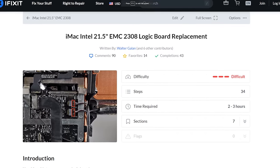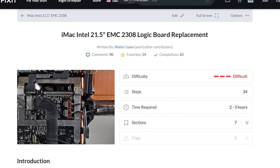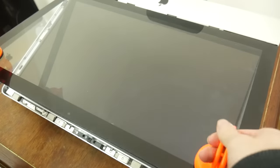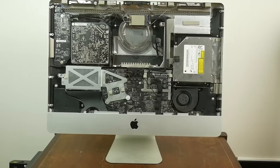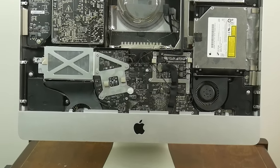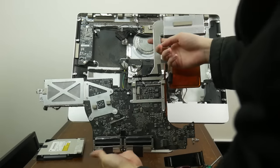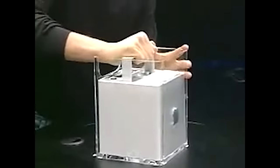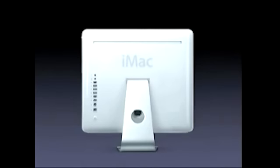Why only have one working iMac when you could have two? I decided to start disassembling the dead 2009 model, which iFixit labeled as 3 out of 3 difficult. And they're not wrong. The only way in is through the screen, so you have to use suction cups to lift the glass off, which is held on with magnets. Then you get a hundred other components and wires out, and finally the logic board itself is tucked into the unibody case, meaning you have to maneuver it without snapping any of the alignment pins. Basically, yeah - 3 out of 3 difficult. Apple used to advertise their computers being easy to open - you just unscrew three screws on the bottom and the back comes right off. Nice one, Phil.